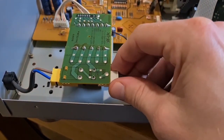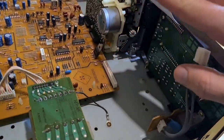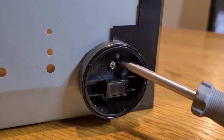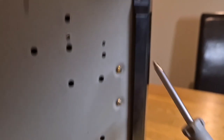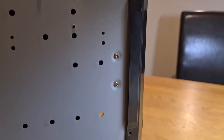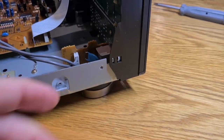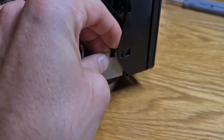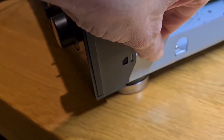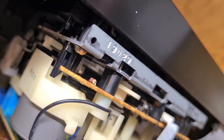You've got your power cable - just pull that one. All that's left now is one little earth cable which we'll get off last. You need to take the face plate off - look underneath and you've got four screws on the face plate, plus two screws holding the transport which we'll leave for now and do last. Once they're unscrewed, the little clips on the side allow you to slide it off. If you put downward pressure on the deck the feet come off too, so it's quite difficult to separate the two.